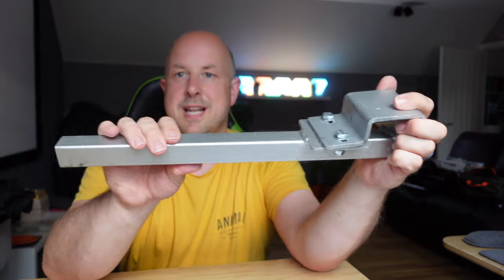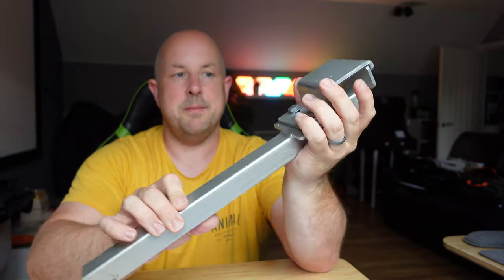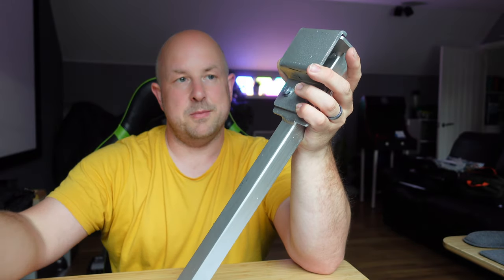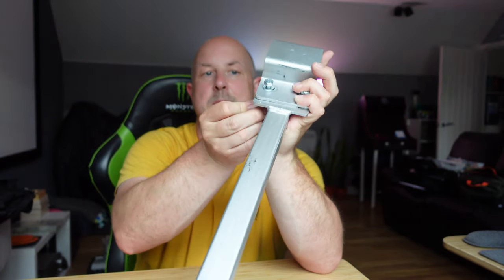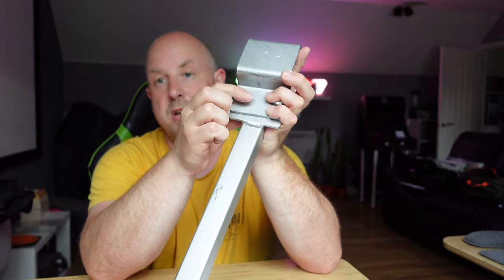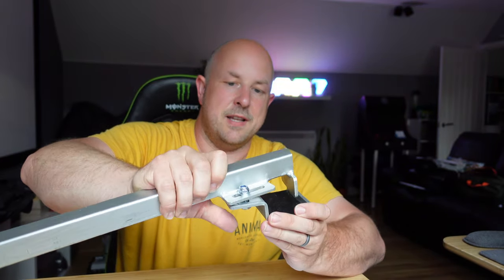And then finally, for this other part that clamps onto the, I guess, other side of your trailer, both the tops and the bottoms of these are 13 mil. So a 13 mil socket you can apply on the top or the bottom to those nyloc or nylon locking nuts. Again, I will use the 13 mil on the bottom to ease doing it up and put the 13 mil spanner on top to keep things all in place. So that's how we're going to use all the tools, and now it's simply a matter of constructing things.